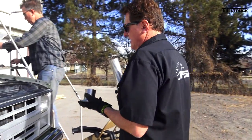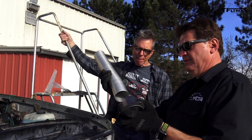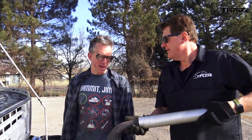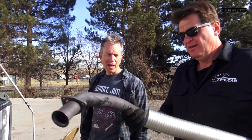So Ted, here's the issue. The headers came with this reducer, which fits onto this extension pipe that we bought. But we just chopped off this pipe. We'll have to get a stepper for this. The plan is to put on the headers and use the current exhaust system so we can drive it out of here, then swap out the exhaust and have a nice one made. For now, we don't even have to attach this to the rest of the system — we can just slip it over and drive it to whatever muffler shop is going to make it nice. It's going to be loud.